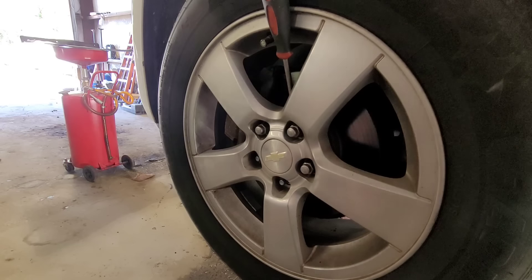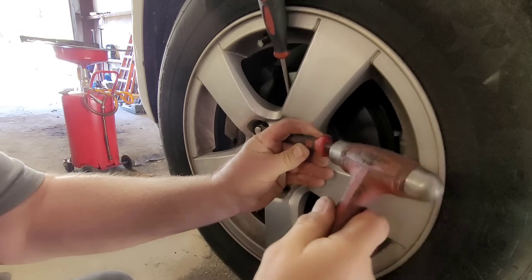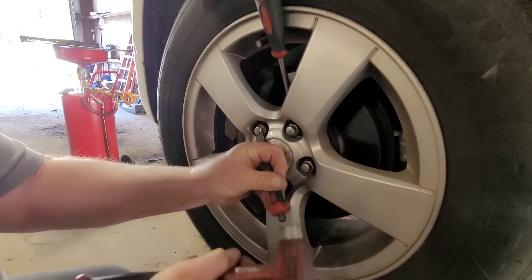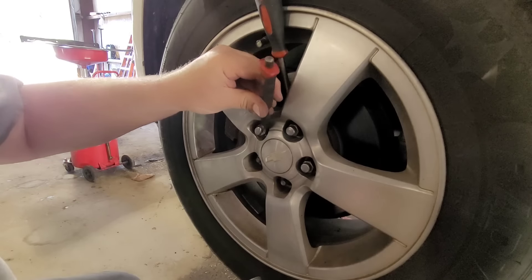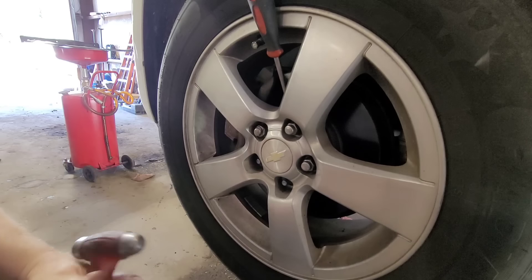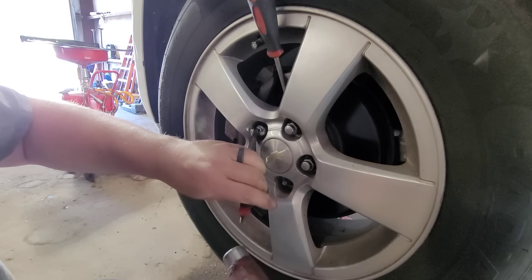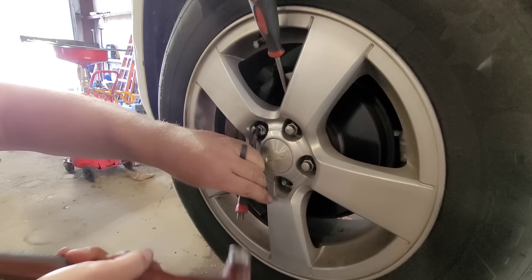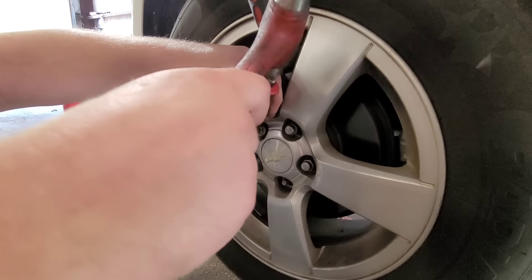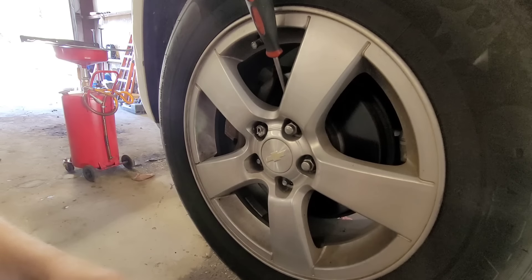What I'm going to try to do is just chop the head of this lug off. I should probably use a sharper chisel, but this is what I had handy. Whenever you have something like this, you have to tell the customer there is a possibility of some minor rim damage. You can put tape on the rim to protect it if you want — though tape is only going to do so much. This rim is far from perfect anyway, but I might do that if I can't get the rest of this off. There we go.